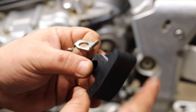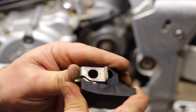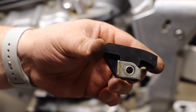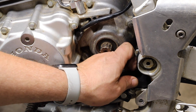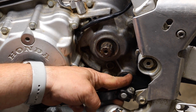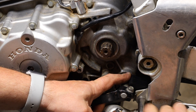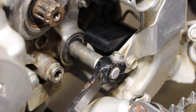Here's a quick look at the new chain block — you can tell there are no grooves, no silver paint, it's nice and rubbery. Before I can install it onto the bike, I need to reinstall the bracket. Slide the bracket into place, then install your bushing, and now we're ready to reinstall into the bike. You'll notice there are some ridges — that is what holds it and ensures you're not going to put it in backwards. When installing this, be sure to tilt it back a bit because it rides very close to the shifter. Loosen it up, push up with your finger, and now you can see it installed — there's plenty of space between the shift shaft and the block.